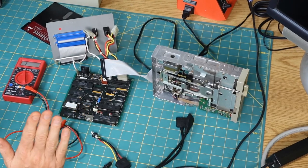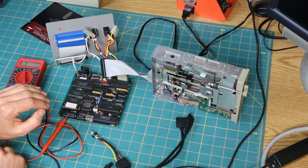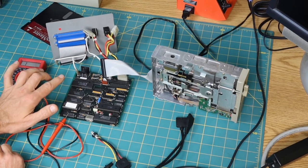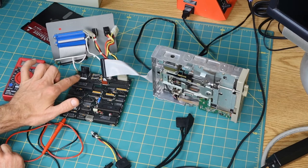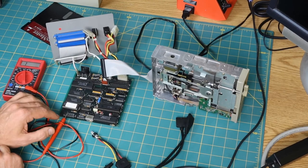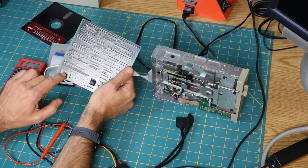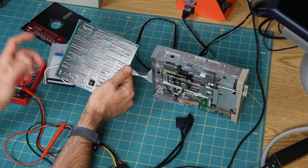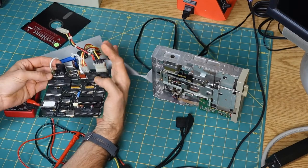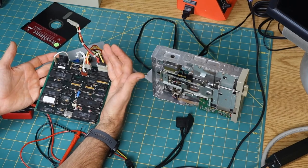Yeah, is the ground. I then did a little bit of research online and found out that there is a compatible power supply, or a power supply that people claim is compatible with this device, that provides those voltages on those pins, which is good news. But also on, I want to say pin 4 back here, it also provides minus 12 volts. And as I've been looking at the board here, it doesn't look like this pin is connected. But then it also doesn't particularly look like the ground pin is connected on either side. So there's obviously another layer in this board where things are running around.